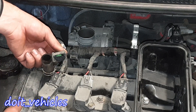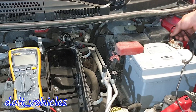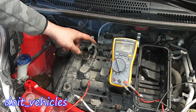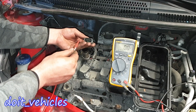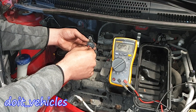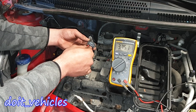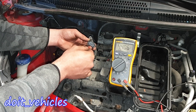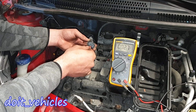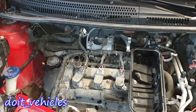You can compare the values at home on your car and see if there is something wrong. Let's make sure we've got a good connection on the negative side, then turn on the ignition. The pins are numbered: pin 1 nothing, pin 2 nothing, pin 3 five volts, pin 4 four-point-four volts, pin 5 nothing, pin 6 nothing. That's pretty strange because we don't have 12 volts.